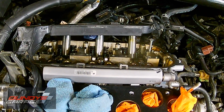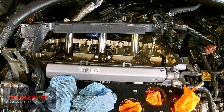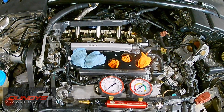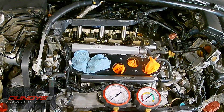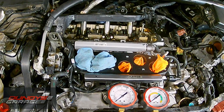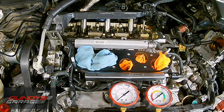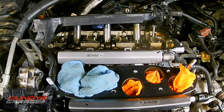I'll show that to you here in a second. I'm glad it's not a ring because I didn't really want to go in there and replace the rings on this thing. There are cases of rings being bad, mostly on the Accords, not really on the TLs. I searched online for anything showing bad rings on the TLs but didn't find anything. In some cases in 2007s, they saw cracked heads on the J-Series V6s — not sure if it's the 3.2 or 3.5; if someone knows, please leave a comment below. But a bad valve stem seal is a lot better than having a bad ring.